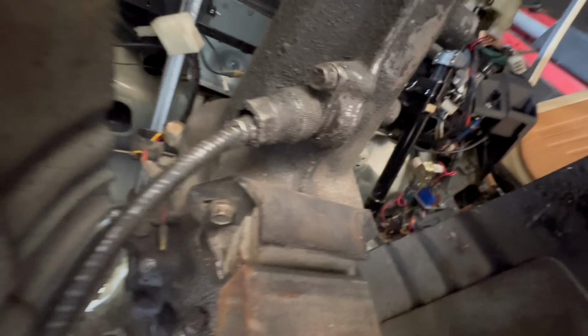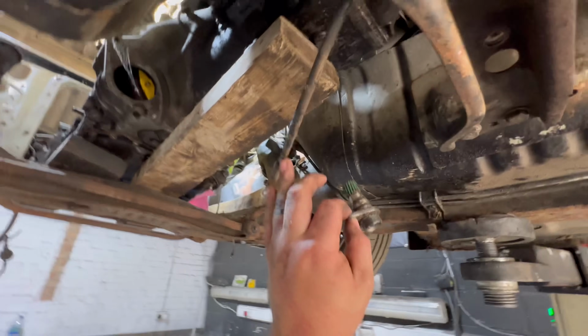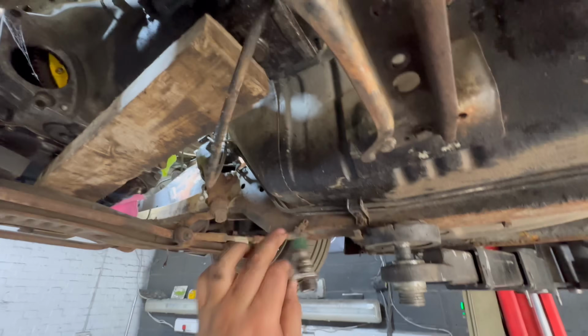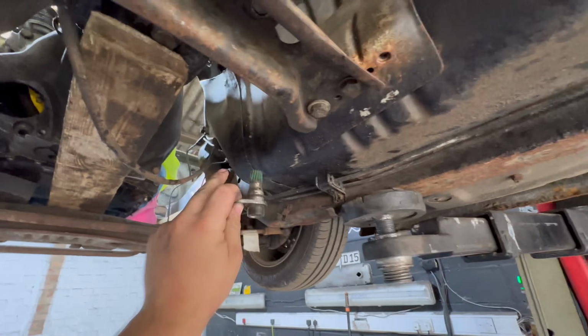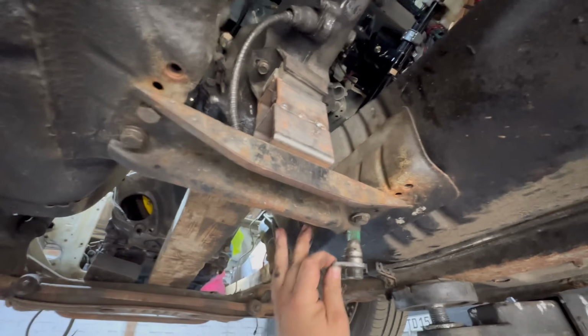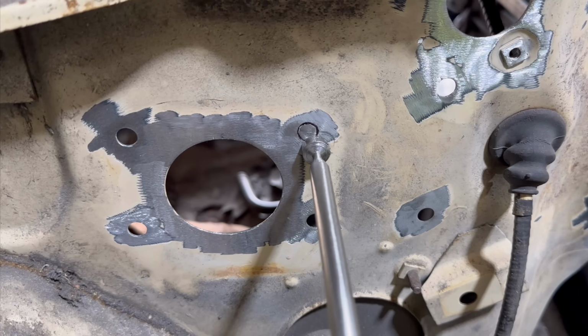After some pulling things apart and putting it back together, we have a Datsun speedo cable mated straight to an RX-7 gearbox. Who'd have thought it? Obviously the cable's slightly long. We'll have to P-clip that out of the way or something, but it used to come in around here. But obviously we have to cut across now, so yeah, something actually works for once. Brilliant. Tedious little circles. A couple more to do.